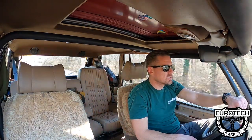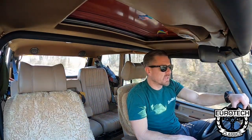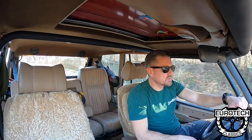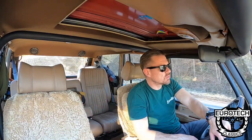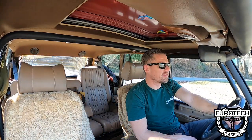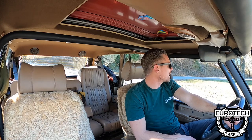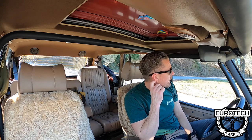Going through all the gears. Did a new master cylinder on it, bled the brakes a couple of days ago. It seems pretty good — it's actually got a nice firm brake pedal. They used just solid discs in the front, not vented or anything like that, so you could probably upgrade the brakes and get some really decent braking power.